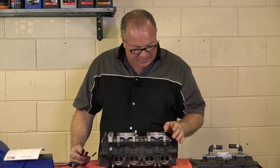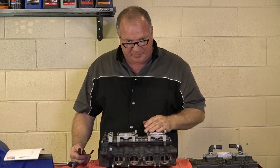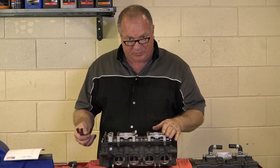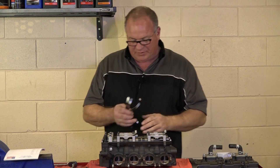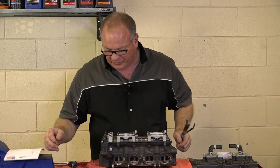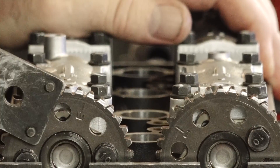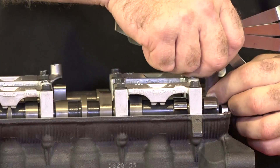Alright guys, we've got it bolted back down. On the intake side — I like using millimeters — that needs to be between 0.12 and 0.19. On the exhaust side, you're going to need to be between 0.16 and 0.23. So we'll start off at cylinder number one and then work our way across. Keep in mind, each time you go to a different cylinder, you have to rotate your cams. I'm just using a tool like this to grab the gears and turn them over. If you've still got the head in the bike, then you just go down to the crankshaft and move it the appropriate distance.